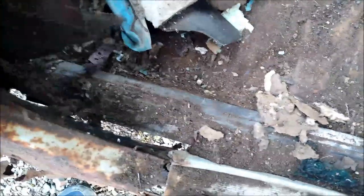In the back, this floor pan here is very, very thin, so I'm gonna need lots of replacement metal from my junk out back. I'm gonna try to fix this up in here, down in this corner. I just need to connect things again. I'm not really worried. I'll seal it up with some kind of sealer or goo, but as long as it's structurally pretty good, I don't have to have full weld beads around the panels.